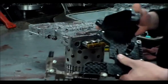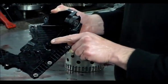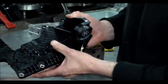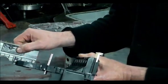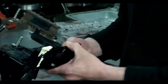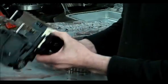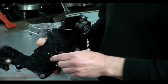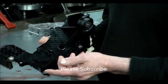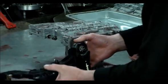On this lead frame, here is your input speed sensor, here is your output speed sensor, and this right here is your temp sensor. Here is kind of like your range switch that hooks up to the manual valve that slides. And your blades for the solenoids, and here are a couple of guide pins. The output and input sensors are hall effect sensors and they help with shift strategy, clutch operation — same as the transmission oil temp sensor — they'll help with shift strategy and converter clutch operation.